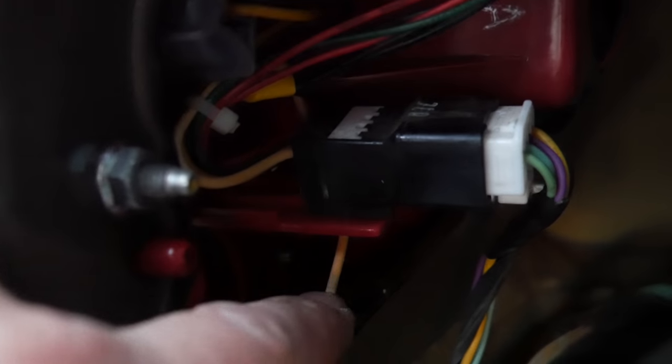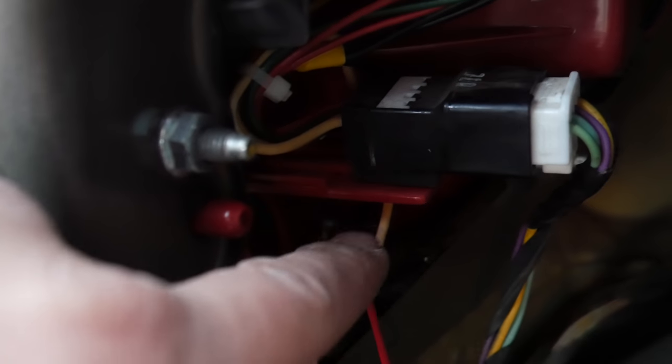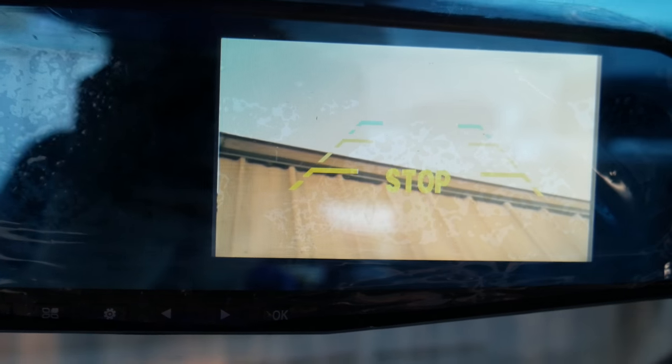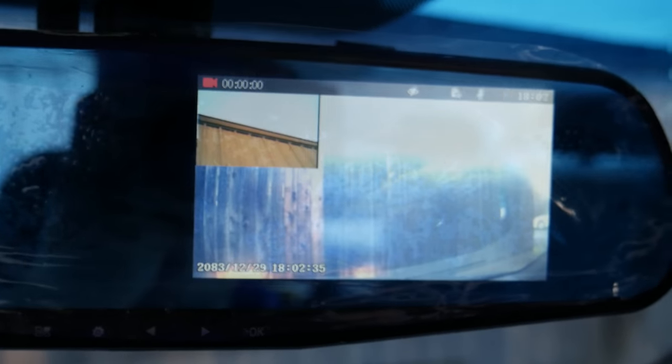I was able to cut through the wire and made an opening to expose the wire. I attached the red hot wire there and the black for ground. With the car on — the moment of truth — when you place the car in reverse it switches to the rear camera automatically. You also have guidelines displayed. Put it back in park and it returns to showing both screens.